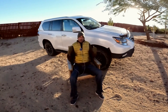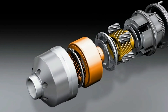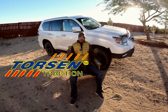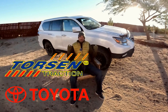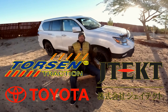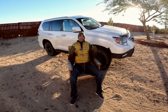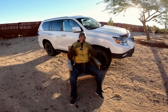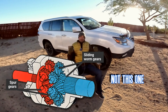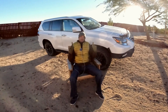The Lexus GX460 has a very special Torsen Type-C center differential. Torsen is so special to Toyota that Toyota actually owns Torsen through their JTEC subsidiary. Today we're going to talk about what makes this Torsen center differential so special, and it's not the Torsen differential with those triangularly arranged worm gears. This is a rarely used Type-C Torsen differential, and it's got a very special trick.